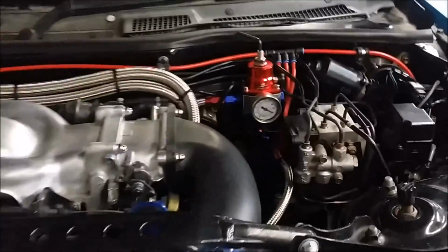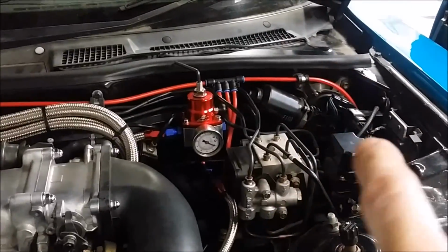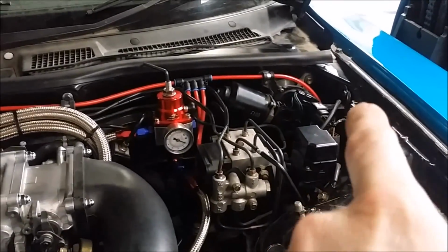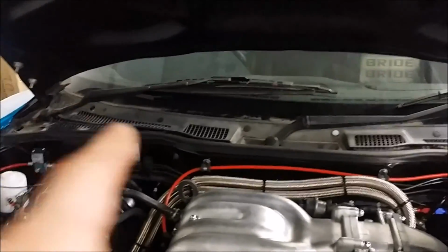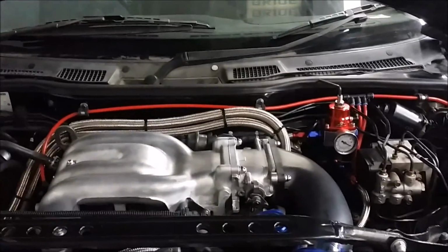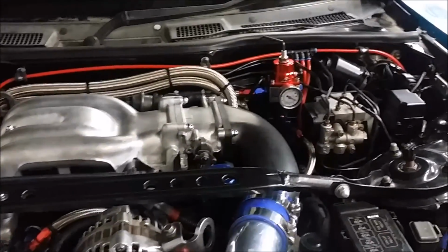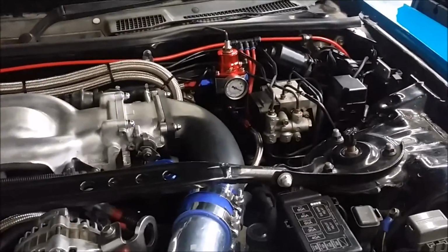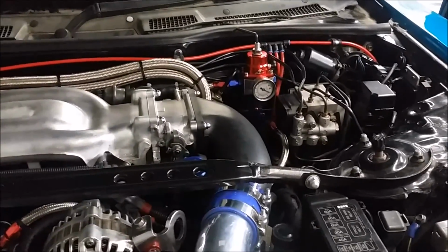So we've got my vacuum line manifold, which is this guy here. That goes off to the Adaptronic. One of them goes off to the factory map sensor. The reason I had to keep the factory map sensor is on the 99s we actually have on our instrument cluster in there a boost gauge, and I didn't want to lose any functionality of my instrument cluster, so I plumbed it in. It's not actually doing anything really other than giving a reading directly to that, but before that's what used to connect to the ECU as well and give information on boost and stuff like that.